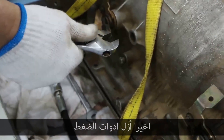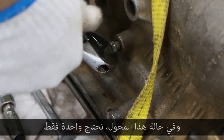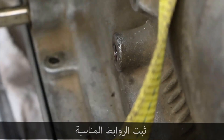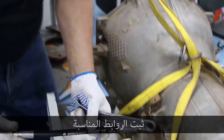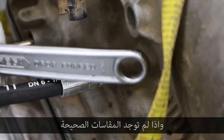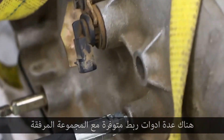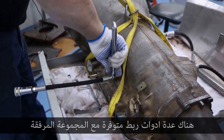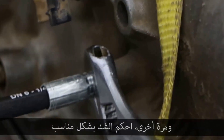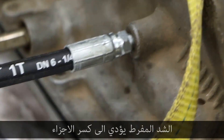Finally, remove your pressure tap or taps. In the case of this transmission it only has one. Install the adapter that best fits into the pressure tap. If you do not have the correct size adapter to fit, there are several line adapters that come with the kit. Once again, you just want it snug — anything tighter than that could chance cracking the case.